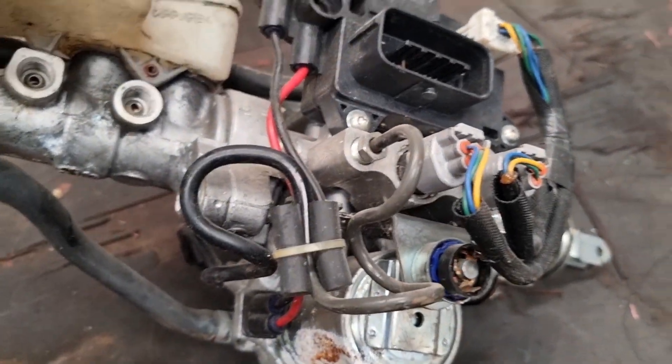In conclusion, it's not a big deal, but apparently in the X-Trail this happens fairly often — this is not the first time I've seen this case, so I was familiar with what was going on. It didn't take long to diagnose: once I saw the accumulator pressure and low pressure code I suspected the motor. I physically tested the electric motor by applying positive and negative power directly and it didn't start. I also requested the motor to start via the scan tool — same result. This can happen in other vehicles too — I've seen it in the Toyota Prius, Prius C, and the Aqua. Just change the motor and accumulator and that will fix the problem.